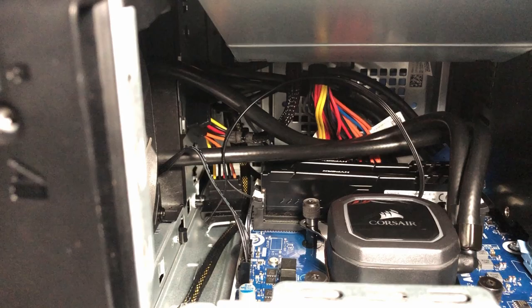In my opinion the hose placement is a bit of a controversy. Since this is a micro-ATX case and motherboard it's better to have the hoses facing the bottom instead of the side as seen in some photos. The most important part in a closed system is having the radiator on top — if there are any air bubbles they will always go to the top. Side-mounting is possible but you're shortening your hoses and increasing the chances of a pinch.